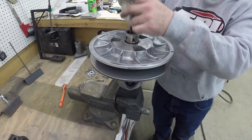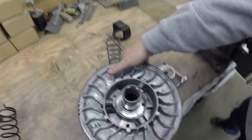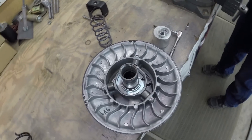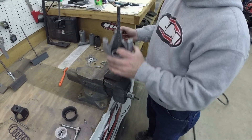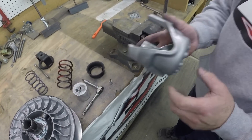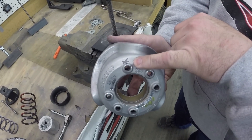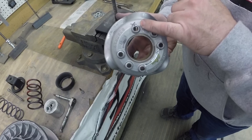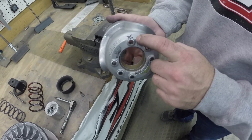When you put everything back together, dry wipe the helix with a clean rag. Also, mark where the spring hole is — if you forget, on a brand new clutch you can normally see where the spring was mounted. When you put the spring back in, make sure it sits through the hole and seats in place. Now is a good time to clean the clutches just like you did on the primary — scotch brite, emery cloth, wipe them down with brake cleaner.